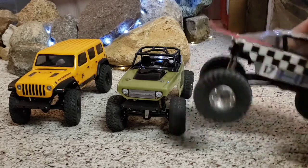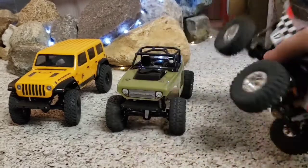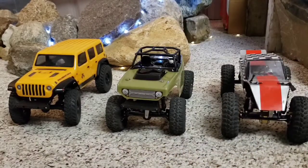These are awesome. It's a huge upgrade over stock. But I would only do them on the back, because if you do them on the front and back, you're going to lose so much roll control just due to overextension of the suspension that first it's going to kill the climb, but it'll also roll over.